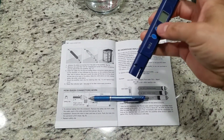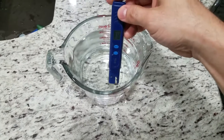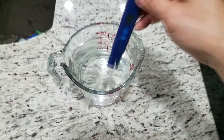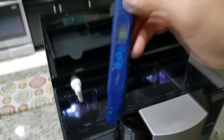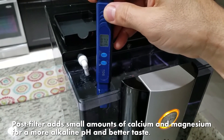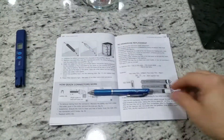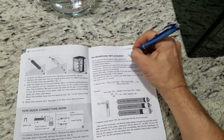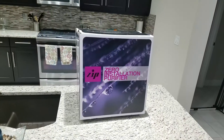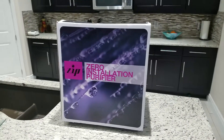The manual tells you to test your tap water with a TDS meter to know when to change your RO filter. I used the one that came with my Zero Water filter. My Florida tap water is about 370 TDS — pretty bad. My RO output came out at 72 to 74. The reason there's still something in the RO water is the post filter adds a little calcium and magnesium, which helps taste and increases the pH. If you've tested Dasani or Zero Water, they come out more acidic — a lot of people believe alkaline water is better for your body.